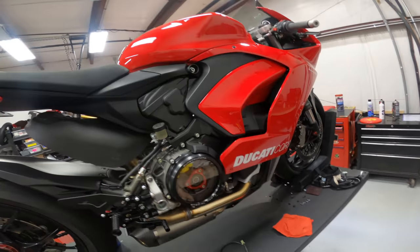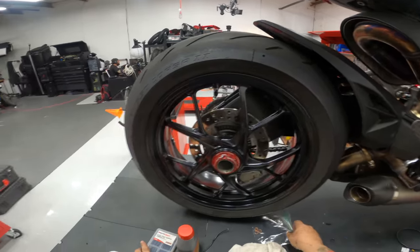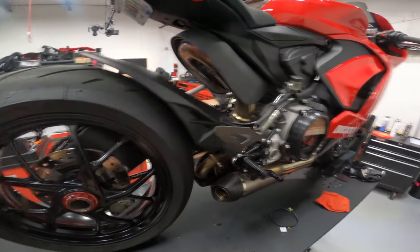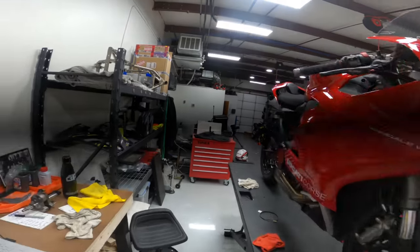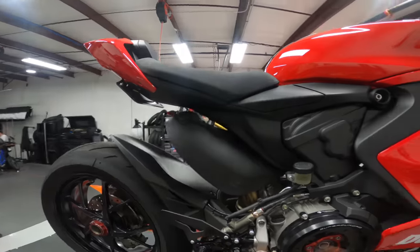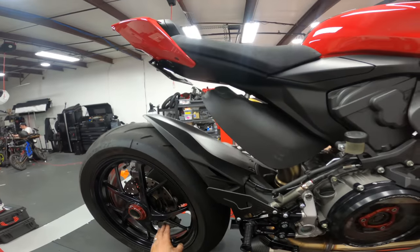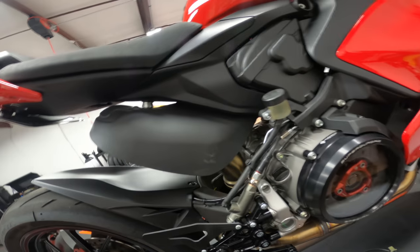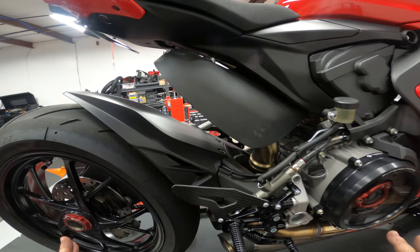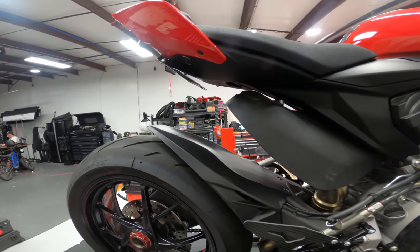All right. I think I'm pretty much done with this thing, minus a couple of pieces of bodywork that I'm gonna throw on now. So, just to go back over where we're at, I had a bit of trouble getting the air back out of the rear brake system. I did finally get it out by removing the rear brake caliper, turning it upside down, and then spreading all the brake pads open to push any air that was in there out. I think that was where it was trapped for me.